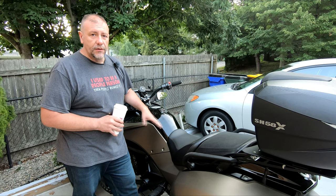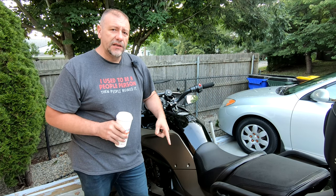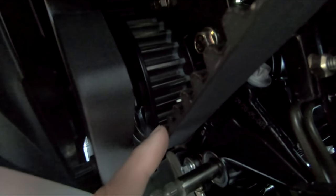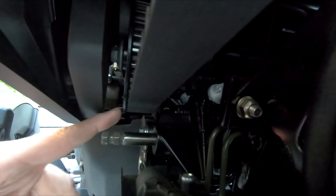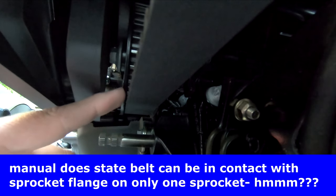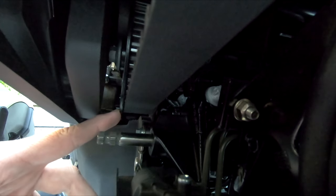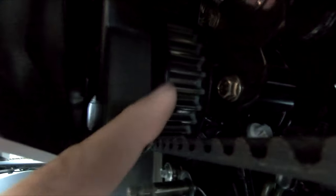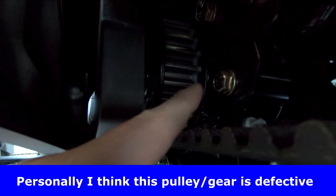It's actually pretty loud and overwhelms the stereo system. Upon further inspection after it started making that noise, I noticed the drive belt is misaligned. This is your drive belt and this is your front pulley — it's up against the outside of the pulley. What's happening is the drive belt is hitting the side of the pulley, and that's what I believe is causing all that noise at 50 miles an hour. You can tell the belt's not centered — it's not hitting on the right side but it's flush up against the left side.